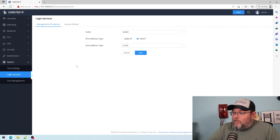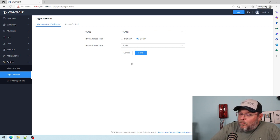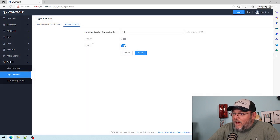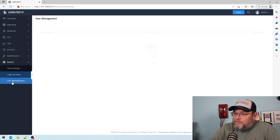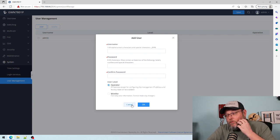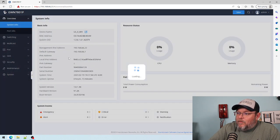We've got our login services — this is our management IP. We're going to be doing VLAN configurations on this and the whole bit. This is just a quick brief overview because this will be the primary switch for the next video series. We can select different VLANs there, and then of course you've got access control. Telnet should not even be an option. SSH is enabled. I can come in and add different users and give them monitor or operator — those are your two levels of security.